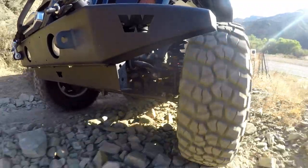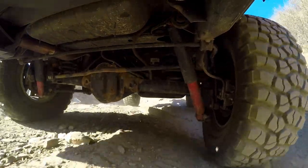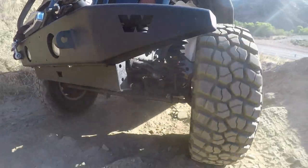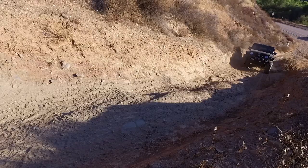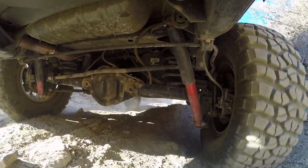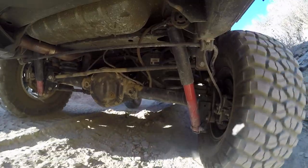We're gonna hop on board, put it in four-wheel low, climb this hill, and see what happens. I'm doing second gear, four-wheel low, sway bar disconnected, and the rear axle locked. Let's purposely put it into some tough spots — putting it right in the hole there. No rub yet, sweet! Now here is the section where it really got hammered last time — and in we go, nothing yet, creeping up. Wow, definite improvement!